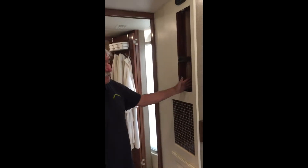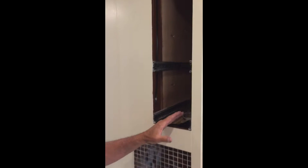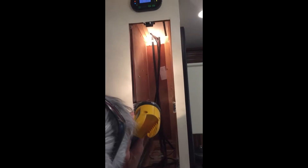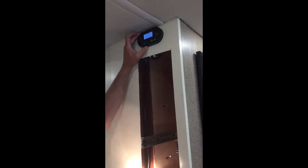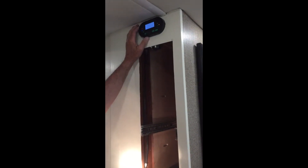We're back inside where we brought the wires down. In this particular unit, it is pretty much nothing but slide-outs. The place we chose to come down through was right here, between the kitchen and the bathroom. There's a little sliding pantry — we took it out and were able to get two holes up through the ceiling and roof to the roof port caps. You can see the two 8-gauge wires coming down in. We ran them down behind and under, and at the same time we're feeding up the remote wire for the remote display panel, because the charge controller is down below, closer to the batteries where it's supposed to be.